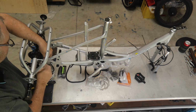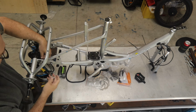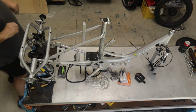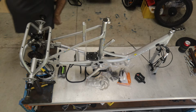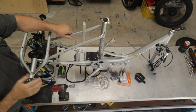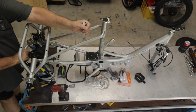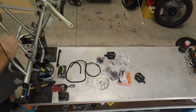Then we come up to one of the most important tasks of the whole tricycle assembly, and that's matching the front frame to the rear frame, but also to keep it nice and aligned so it's not off at an angle. Really important. Now when we're doing assembly, because we've been doing this for years and years, we use electric tools, but for most of the assembly we actually use 12 volt. Not 18 volt, because a 12 volt is a much lower torque setting and makes it much easier to do without over tightening everything.